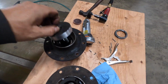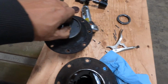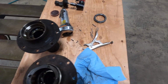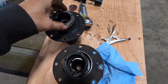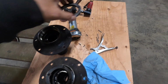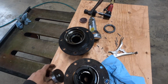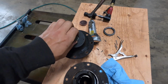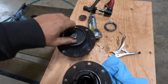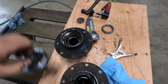Okay, so I machined this to fit further down past the threads, but that wasn't until I first got the 2 collars out on each of these. So the first one came out and didn't have to clear the thread. So I got those removed, and then I machined my tool down another step, so that way it would fit past the threads on the lower one. And then hopefully I'm going to put the other pins in and impact them out. Let's hope it comes out.